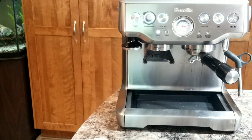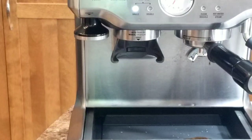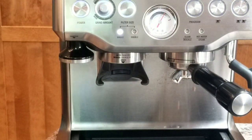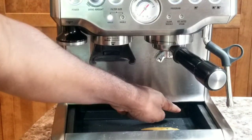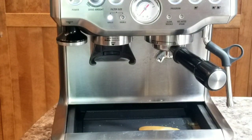Watch the pressure meter now. As you can see the espresso is dripping — we got some flow in the pre-infusion stage, but now it's just dripping. I'm hardly getting any flow. This is obviously over-extracted. I'm not going to stop — I'm going to leave it to extract. The extraction is happening and if you notice I am getting some backflush — the reverse flow of water. It's still dripping.